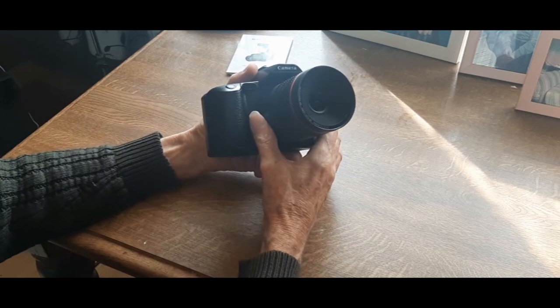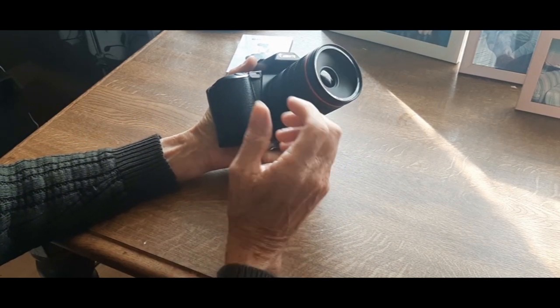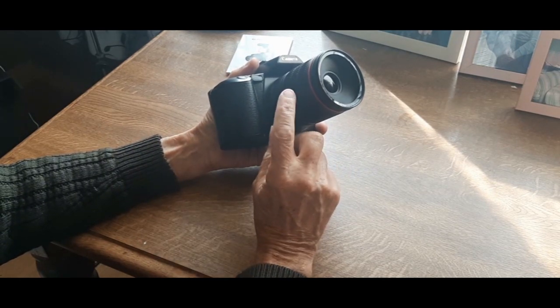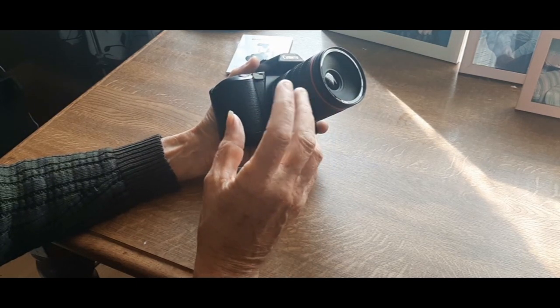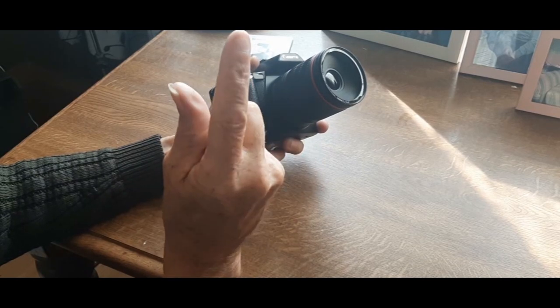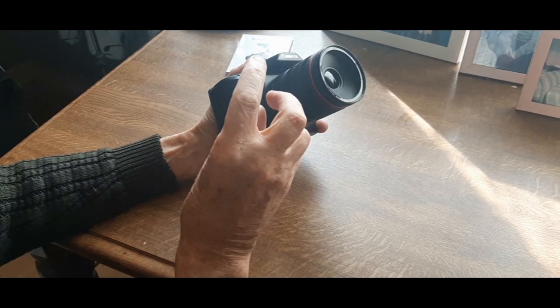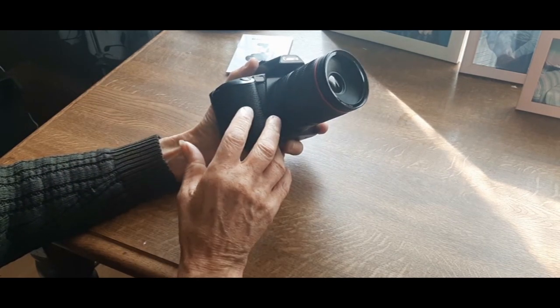Now the only thing I would say is the sensor on this is extremely sensitive. It does really pull in the light, there's no doubt about that. But on night vision, it becomes extremely pixelated. So I found for best results you knock it down to -5 on the exposure settings, and that works absolutely perfect.